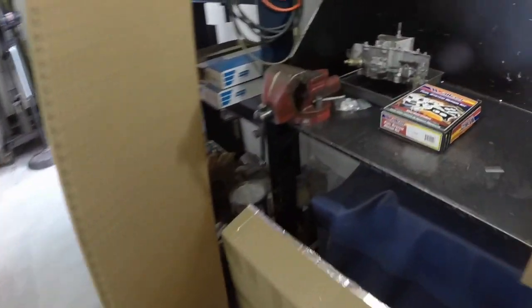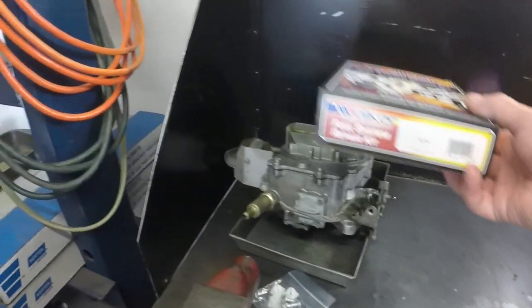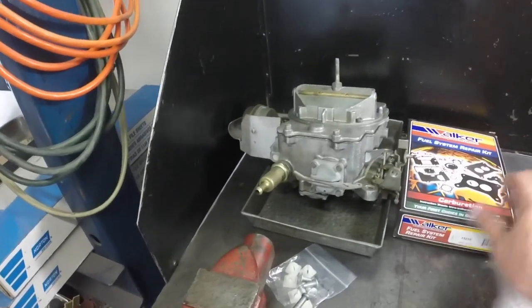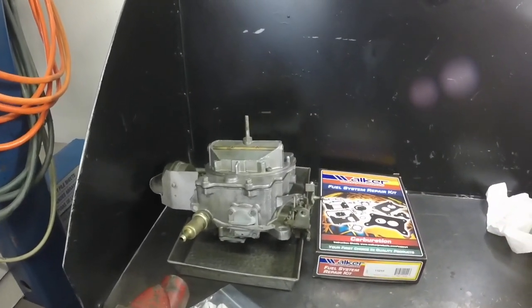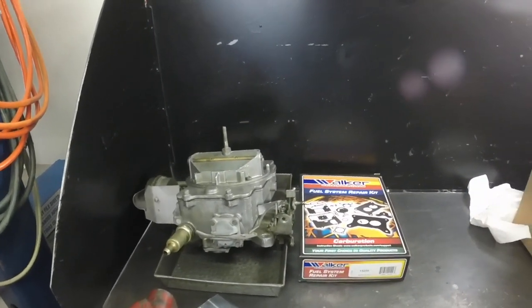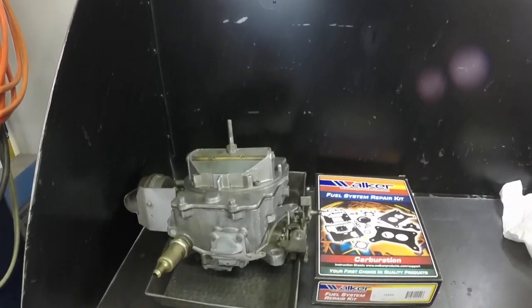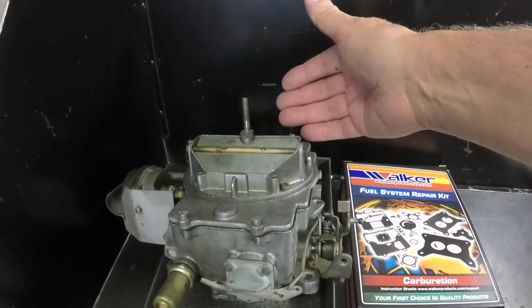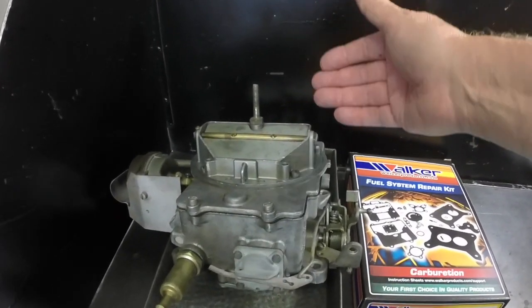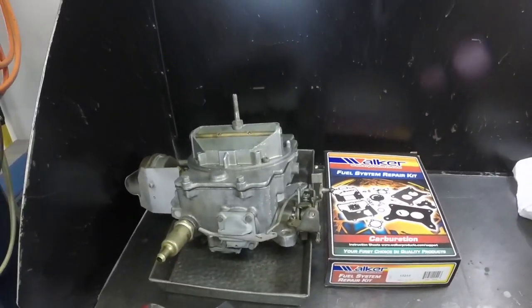And I'm going to go through this carburetor. I got another carb kit here, and I'm going to go through this carburetor to figure out what was blocked up in it or what's causing the engine performance issue. Something's got to be clogged up in it still. And I don't know if it's a secondary idle circuit. I didn't realize the secondaries had an idle circuit. Most don't. So if it's running lean because of that, yeah, that could cause it to.